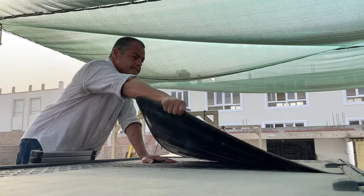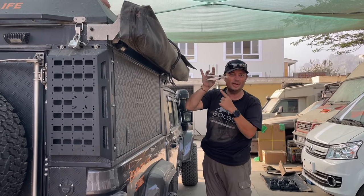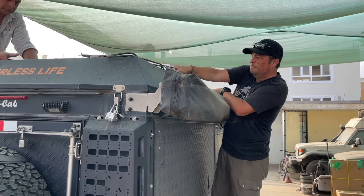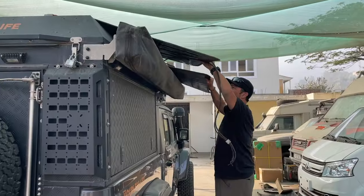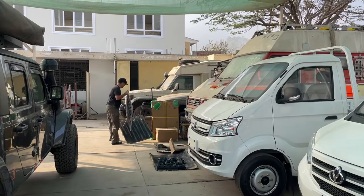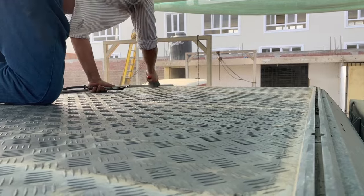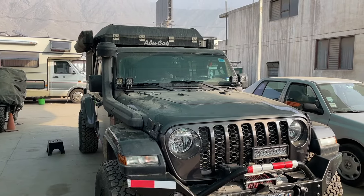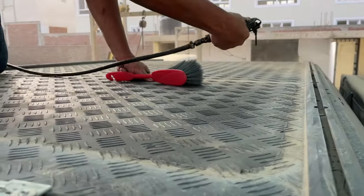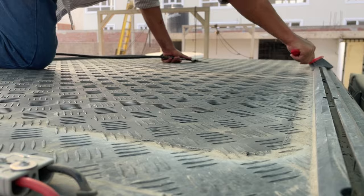We got the Red Arc panels and we're so excited to install them today. We're taking off the old solar panels, which were just stuck down to the roof of the Alu-Cab — using my Leatherman, not sponsored. Installation is always an 'if' with us; we are learning as we go. Next step is to clean off the top of the Alu-Cab. Carlos is blowing and sweeping off the dust and then we'll use some thinner to really get it nice and clean.